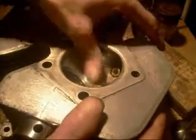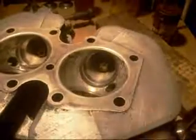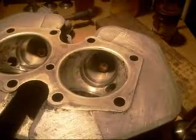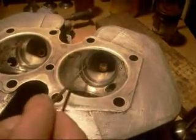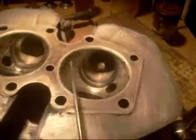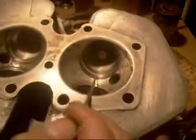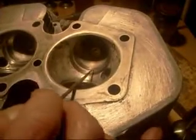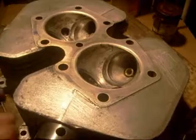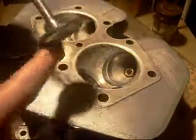It's getting closer. I now have the engineer's blue all the way around from here to about there. About here somewhere it is down to. So I've still got that portion where the valve isn't touching. So, back again. Get some more rough stuff and another five minutes.